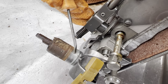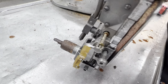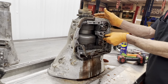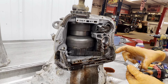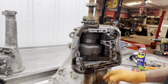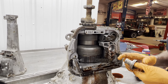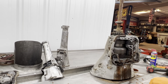A lot of times the water seeps down and just eats all this up right here. You want to Scotch-Brite this part here off so the levers slide down a little bit easier. Now remember, the valve body we're using is a fully manual Cheetah valve body. In our other video I had the accumulator spaced all the way out — we put a slug in here to hold it all the way out. Once you put it in there, you've got to check your distance from here to the valve body, because if it sticks out too far it'll hold the valve body up from sealing and it'll leak. So you want to make sure you put the right length slug in here. Blocking it is definitely a lot better for a firmer second gear shift.